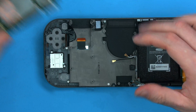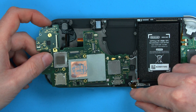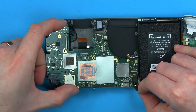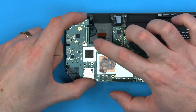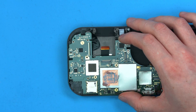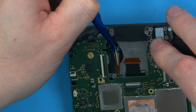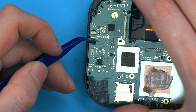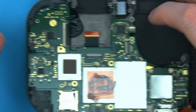There's a lot to think about here, but if we do this right it's fairly easy. Start by looking down this corner with these two ribbons, make sure they're sitting over the board, hold one out the way, and slide the board into position. So now we have this ribbon out the way, the battery out the way, and these two sitting above. Before laying it down, focus on what's in this area — the touchscreen ribbon underneath, gently get it with tweezers and move it out the way so it sits on top of the board. And the Joy-Con ribbon: gently lift the board up and pull the ribbon around. And we have all ribbons in place.